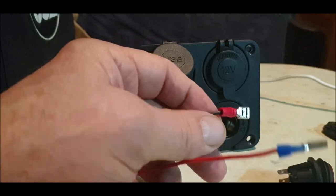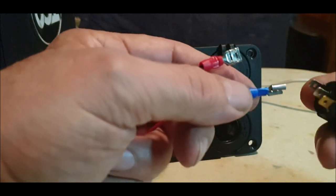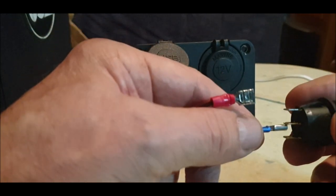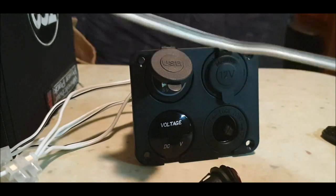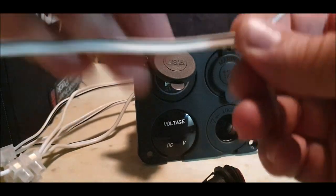Okay, on this one, you have to bear with me a little bit because there's no positive or negative. I gave it a quick test, and I know there is a live in the middle. So what we'll do, we'll put a spade on. I've just done another piece of wire. So we need the direct live going in, and then this is the switch wire to a bulb, and I'll show you what I'm doing with that. So we'll do another connector on here,